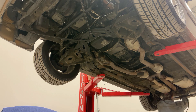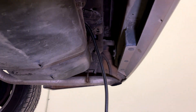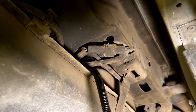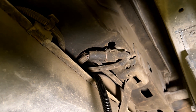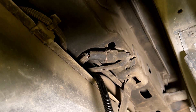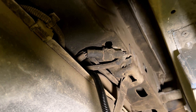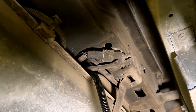Finally, feed it over the top of the fuel tank to the back of the car where the pump connector is located. Once you have your wiring pulled back here, the next step is to splice it into the factory harness. That connector ties the body harness to the fuel tank harness, and inside there is the factory fuel pump wiring and the factory fuel pump sender wiring. So we're going to open that connector up, identify the fuel pump wiring, and splice this new harness in through a new relay and into the body side of that connector.